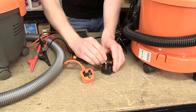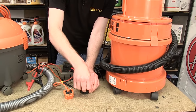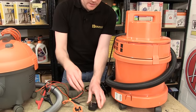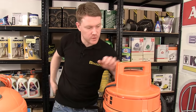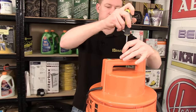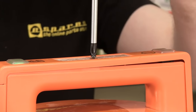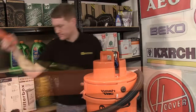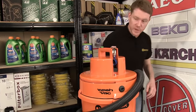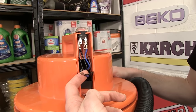If I return the fuse to the plug, the next place we need to check is where the cable meets the switch. In order to do this I need to remove the top of the switch cover. With the switch cover off, you can see that we actually have a loose connection to the switch.